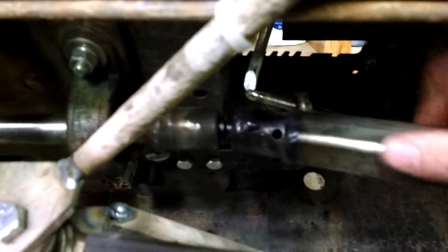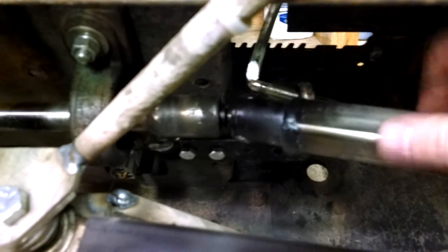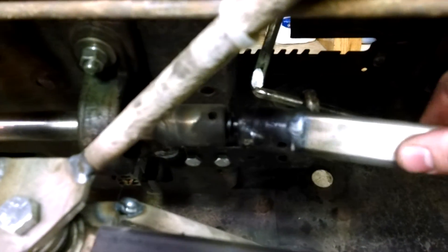As you can see, it's a half-inch impact wobble with a little bit of grease on it. The pin that goes through that joint was originally held in by a spring clip, but I welded the pin so it couldn't fall out. Then it's a piece of square tube and another piece of square tube that slips inside — that's the slip yoke, just like on a car or truck drive shaft — and that goes back to the second joint right at the rear end.